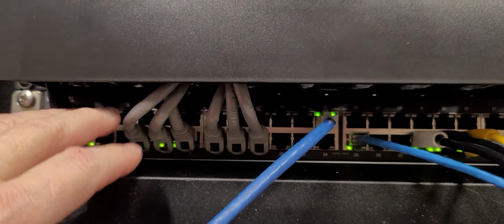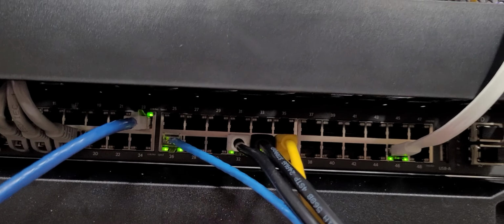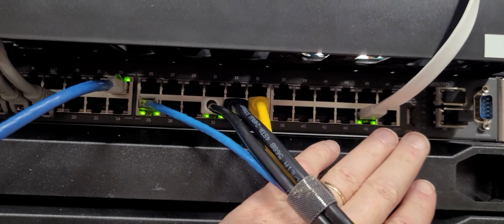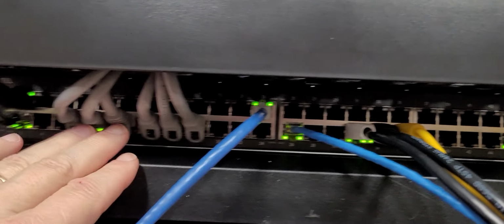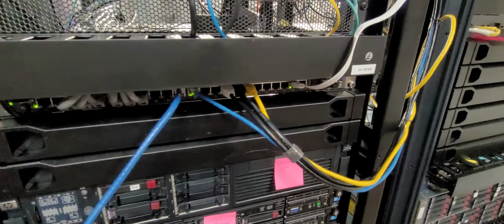And if you can, channel sect means the following. Channel sect basically means that you've actually got blocks of bandwidth here. Okay, we have 4 sets of 12 ports for a 48-port switch. So because of that, those blocks are actual kind of like channels. And it's smart to put 2, 4, 8, 12, and 16, which will spread out your bandwidth. You get as much out of that 1 gigabit port as possible. But don't do any more than 6 ports on a 16-port switch or 4 ports on an 8-port switch.